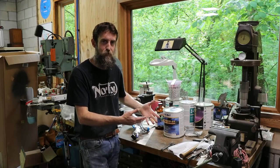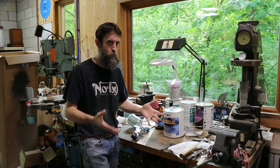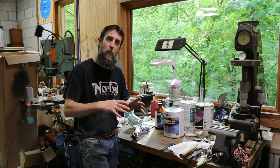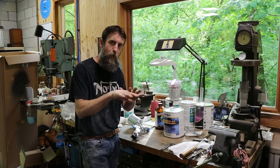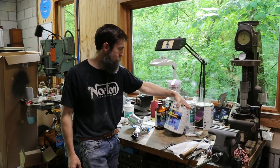This is your last chance, right? This is a building product. We're still in the shaping stages of those doors. Spray this on, give me a good build up. I'll block it down. It'll seal in all that bodywork and keep it all nice and sealed up and give me enough product to get that final crisp shape that I want. And I'm hoping that it turns out nice.